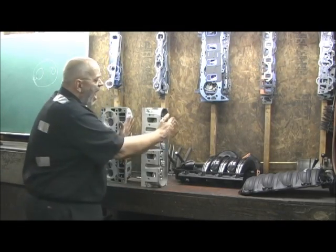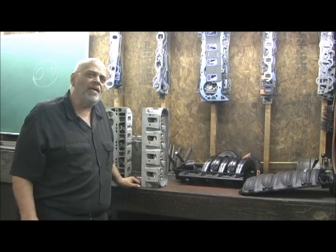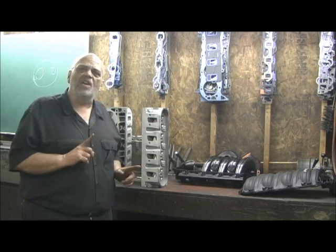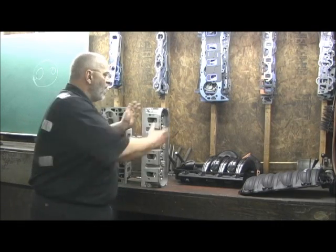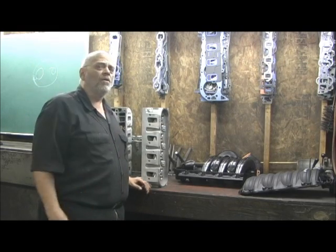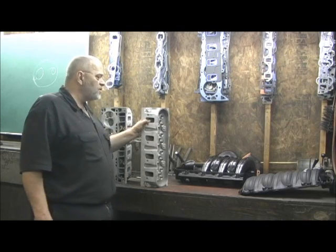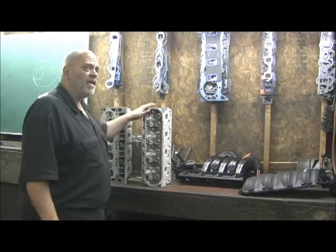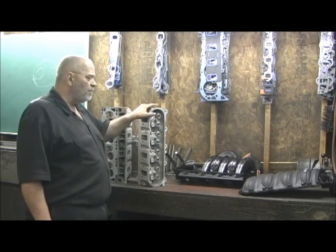You can tell by the height of the head. If you really want to know how awesome a cylinder head could be, there's one area you can look at — most people would never guess it — look for the length of the valve. How long is that valve? Because the longer the valve, the taller the head, the higher the elevation angle, the higher the short turn radiuses. And this right here is just awesome. So we're going to be going in here and giving this a full stage four all the way through — intake, exhaust, and combustion chamber.